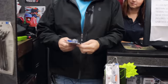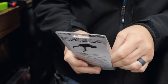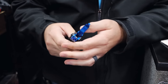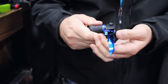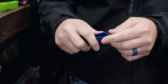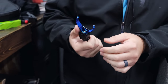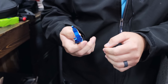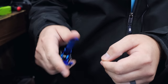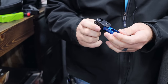What you got new this week? We've been showing the swivel button clip tool. Pretty neat little design — it's for like the evap lines and stuff that you have to squeeze and it pivots. Also for fuel lines, something like that. They made them with the cable that you could reach up in there, and those are still really good, but you don't really want to fight with the cables when you're undoing it from like the breather box or on top of the valve cover. This is just quick, easy, and you can move it any way you need to get the job done.